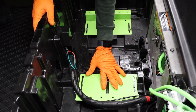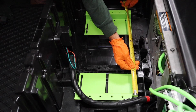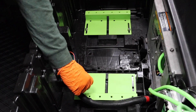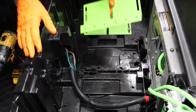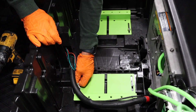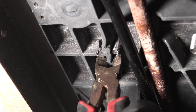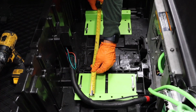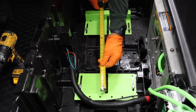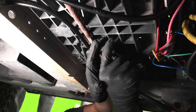Next, place the second mounting bracket in place. Measure 21-and-a-quarter inches from mounting hole to mounting hole and mark the mounting slots. Remove the bracket, drill the holes, reinsert the bracket and the mounting hardware. Go under the golf cart and cut away any formed plastic that obstructs the washer and nuts. Hand tighten, then re-verify 21-and-a-quarter inches from mounting hole to mounting hole before tightening the mounting hardware.